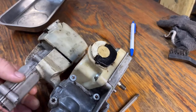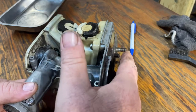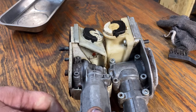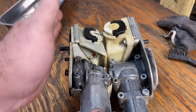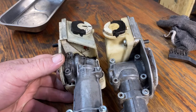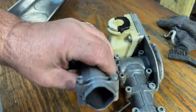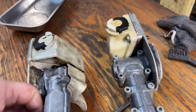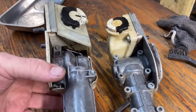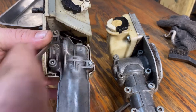The first thing you'll notice as a design change: originally, the bars were on the right-hand side of the pole saw. Now with the new design, they've determined that the line of sight is better, so they've moved it to the left-hand side. Also, on the older style pole saws you had a round shaft — the new one is different, you cannot interchange them. We know that basically the tank and the functions are the same, but I can also see where part of this is gone where the hose comes from the oiler around — a little different style there.